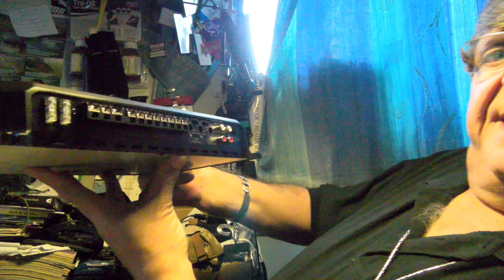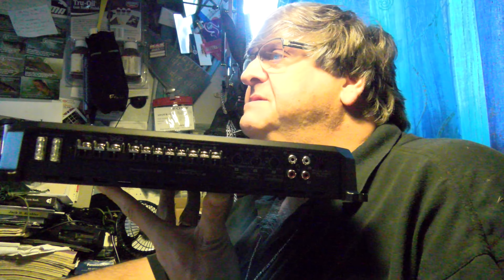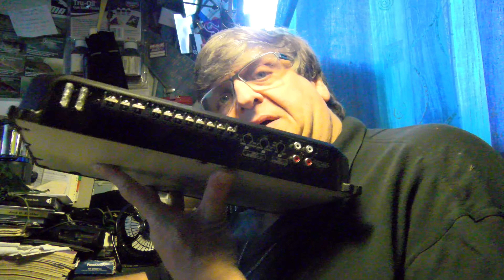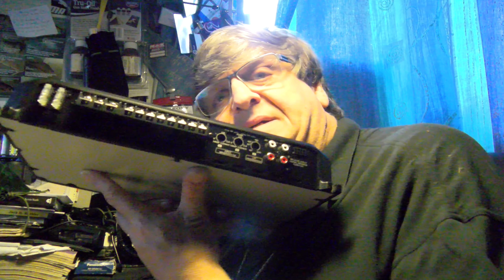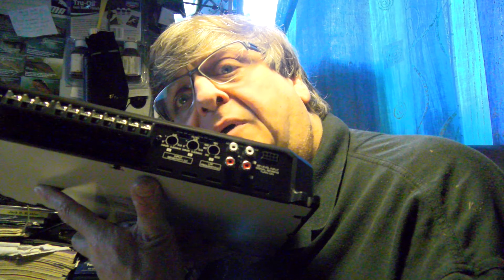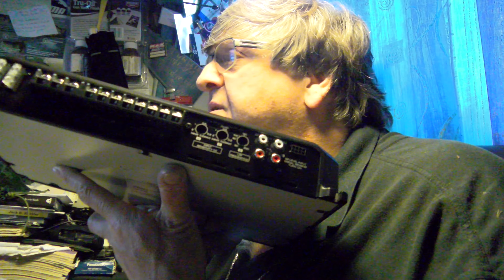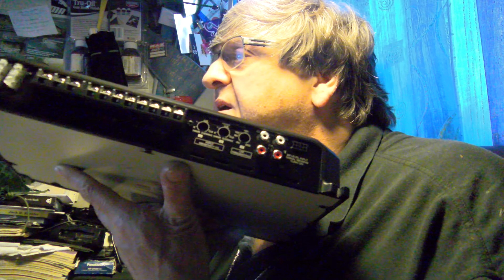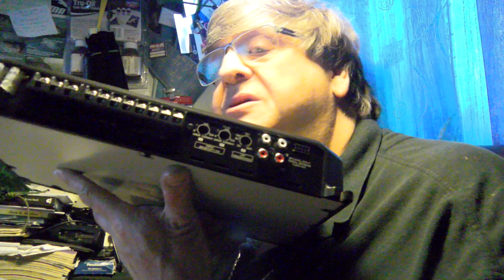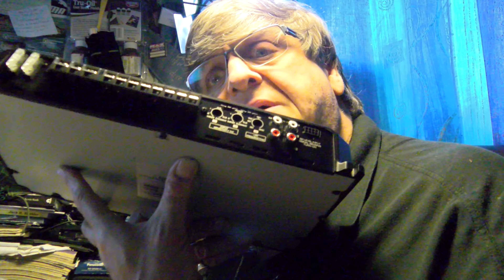There are some filters on there. I'll do a bit of a crib off the details I've been sent. The high pass — meaning it lets the highs past and descends off the bass — is at 80 Hz, which is a fairly standard crossover point, and that's at 12 dB per octave. The low pass, which sets where the subwoofer operates from and allows the lows to pass, you can set between 50 Hz or as far up as 200 Hz, but that's at 24 dB per octave to keep mid-bass out of your woofer.